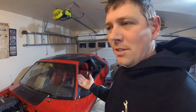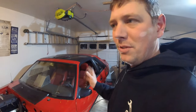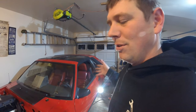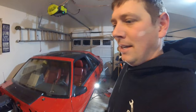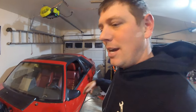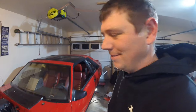I know that sometimes with the spool, if you turn too tight, you can have some chirping of the wheels. It is what it is. You have to be willing to understand what you're getting into. I'm fully aware of how a spool is going to drive on the street, and I'm okay with it, but I guess there's some people that might not understand, right? Tight turns, tight radiuses with a spool on the street is not what you want to do.